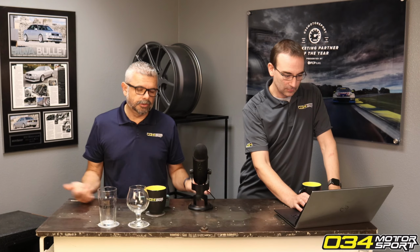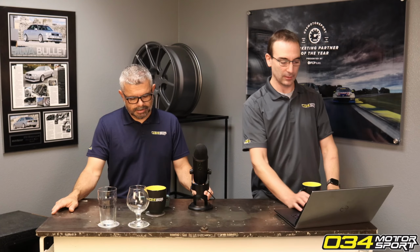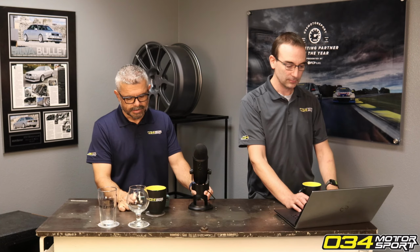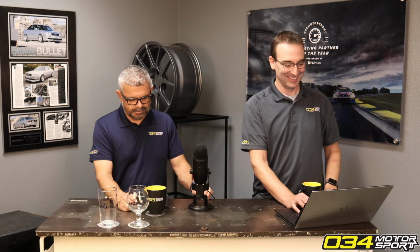A tuning box, you can just sell it to anyone else. It doesn't go with an ECU. Right. We know with the ECU side, you're almost always locked in. And please do not run a tuning box with our tuning. No, that's not how it works. I know people do that. People also vape, and that's also not very smart.